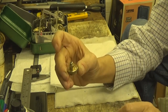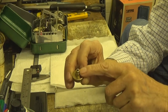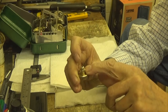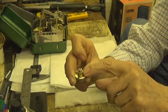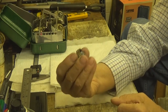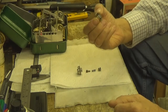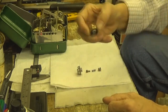This actually is a fixed nut — it doesn't do anything, it doesn't unscrew. It's the very top piece that unscrews out of the nut. I actually did see someone tightening this cap up onto the tank with a spanner on that nut. It doesn't need to be that tight — it's only to make an airtight seal, which doesn't take much effort. If it still doesn't seal, that means you need to replace the rubber washer in here.